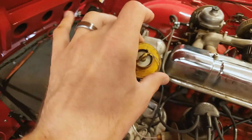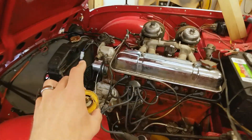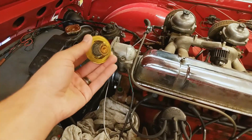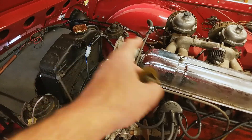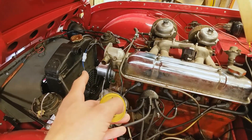We don't have a bellows thermostat. So what we're going to do is actually block this port and use a standard thermostat, but drill a small hole in the outside of this thing to allow the water to continue to circulate, because that is important, as Dad was saying earlier.